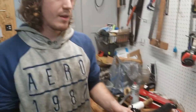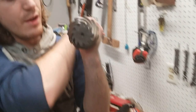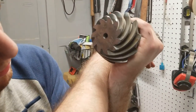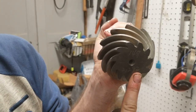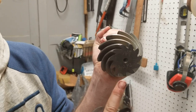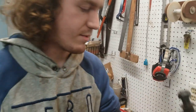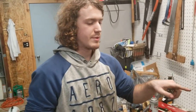The pinion depth is stamped on the front of the pinion: 2.292, plus or minus 2 thousandths. That's what we're shooting for — I'm shooting for plus or minus 4 thousandths just to be realistic. Once we take our first measurement with the 30-thousandths shim, however far off we are we can figure out how many shims to add or subtract. We should only have to do this twice.